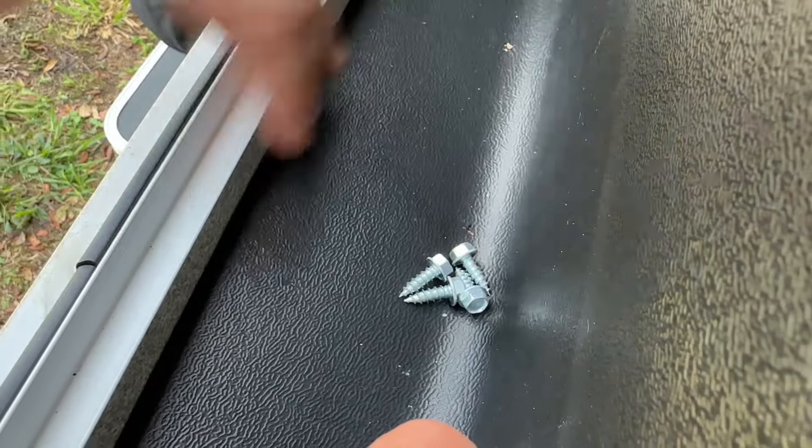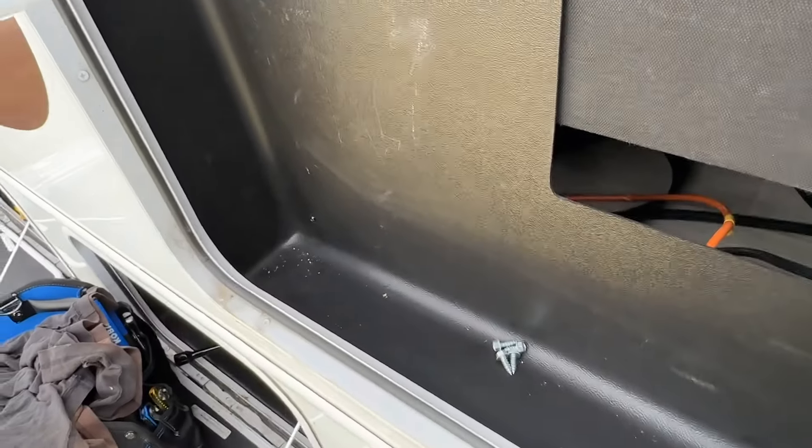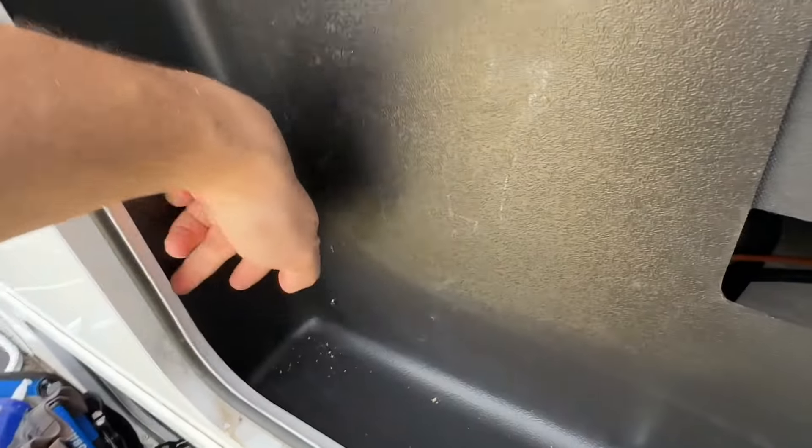The number one fix for this is to silicone it. I'm going to use 100% silicone and run a bead on the inside of this unit where water can potentially sit. I'm not going to go all crazy and go all the way up the sidewall — well, I probably will since it's mine. On the Holiday Rambler, the material was actually metal in two pieces, and water seeped through a crack. You can see it running down the wall — it kills these walls. This is just thin Luan wood behind the wallpaper.